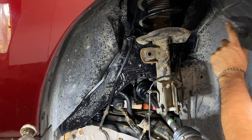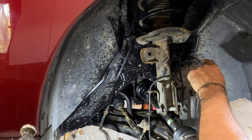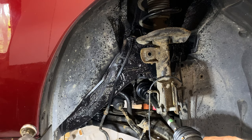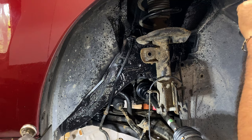The fender liner here is just plastic, held in place with clips. You can use a tool like this — it's just an angled pry tool for removing clips. I bought a big bag of replacements because they're also the clips used for the aero panels underneath. If you search on Amazon for QGZ054 you'll find these parts. It's just a pin that's raised — you pry it up, the bottom relaxes, and you can pull that pin out. Remove just a couple of them to get to that ABS harness.